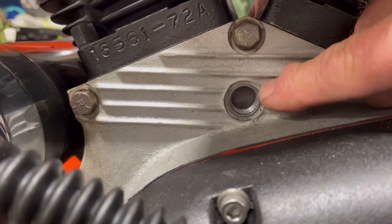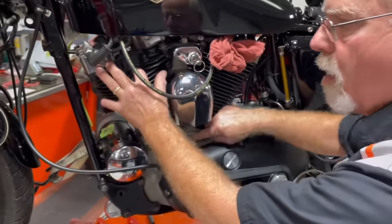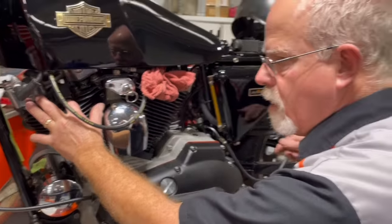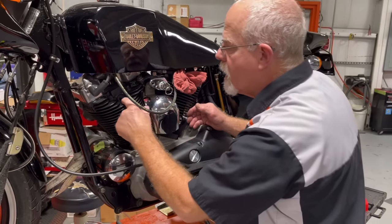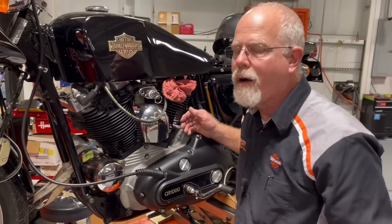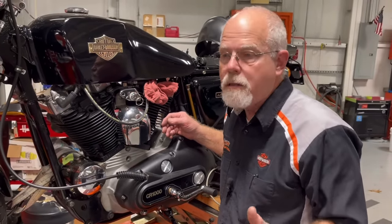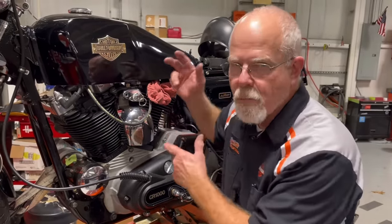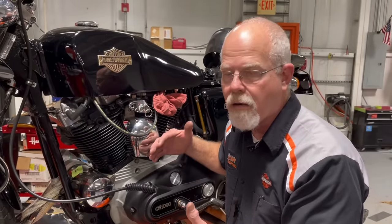What we want to do is put our thumb over the spark plug hole and rotate the motor until you feel compression on your finger. Then you look in and get the piston as high as possible. Now, if you are an engine builder, it's a whole different ball game. I'm trying to talk to those that don't know about collapsing the push rods, watching the intake go up and down, the exhaust staying, and getting top dead center.